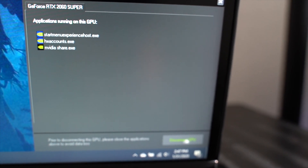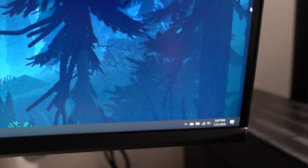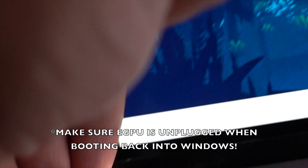Remember to disconnect in the Nvidia Control Panel if you're going to switch back to macOS, and then unplug. Super important — make sure you unplug that. Also, every time you want to reboot your Mac and go back into Boot Camp, make sure you unplug the eGPU because you will sometimes get stuck on the Windows loading screen.